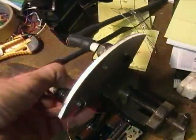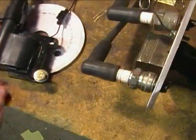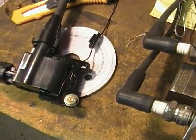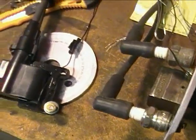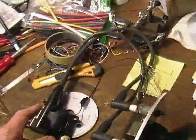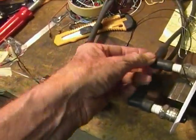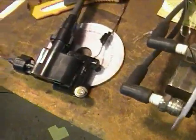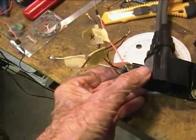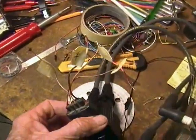The next step will be to add this 90s Toyota RAV4 CNP coil to the system in place of the existing point system and Onan coil. This took some adaptation because it uses tiny little spark plug wires, and I couldn't come up with a handy way to convert from the small spark plug wires to big ones to make up just the right length of cable. I've already tested this system with another simple setup and I know that five volts does indeed fire this particular four-wire coil.